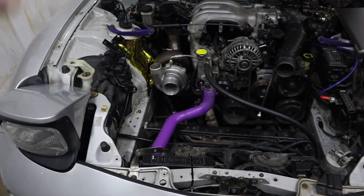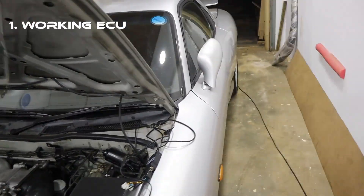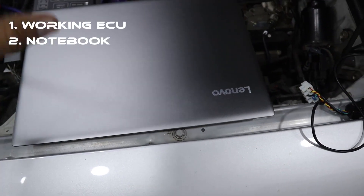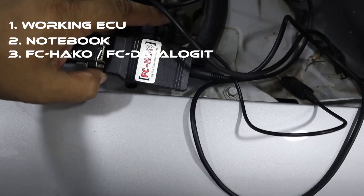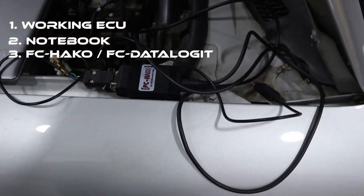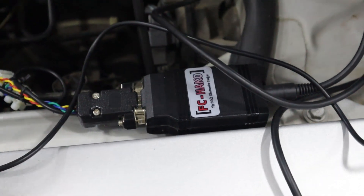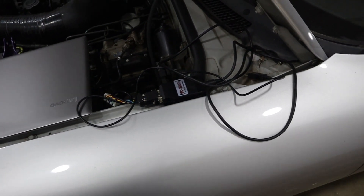Let's dive into a couple of things that you're going to need to accomplish this. Number one, you're going to need a car with an engine — okay, maybe not with an engine, but at least with a running, working ECU. Number two, you're going to need a notebook or computer with an extension cord that reaches your vehicle. Three, you're going to need either an FC Hacker or an FC Data Logger. Both these devices allow you to talk to the ECU, change multiple parameters, and obviously load your own custom maps.